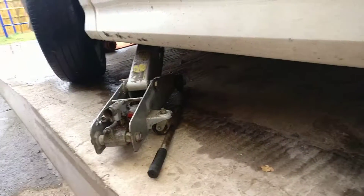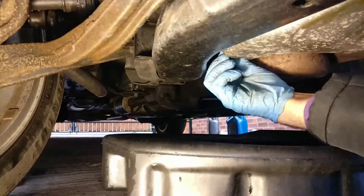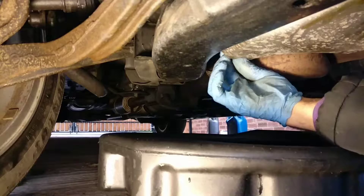The car is already on the ramp. I'll get my tools, remove the bottom plug, and drain the old oil out, remove the filter, and show what I'm going to do next. The drain plug is 17mm.